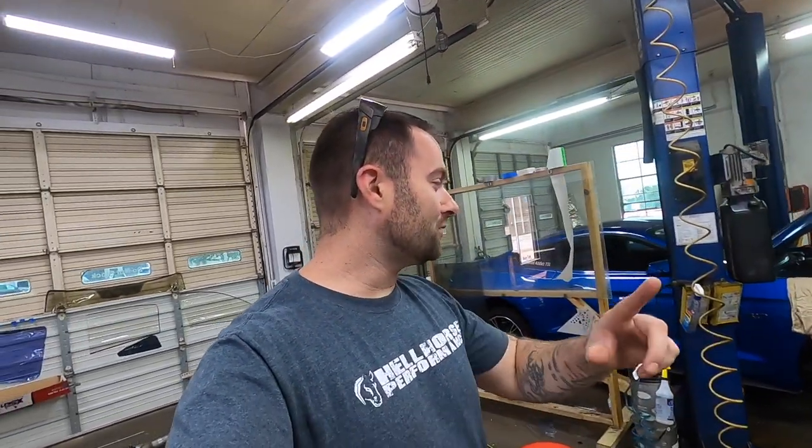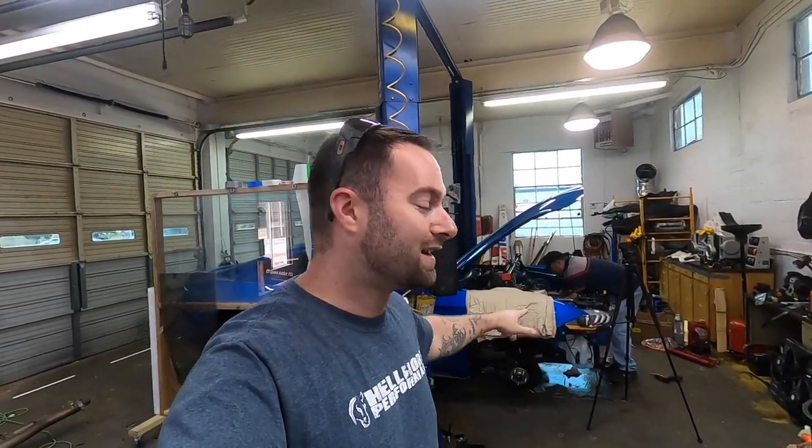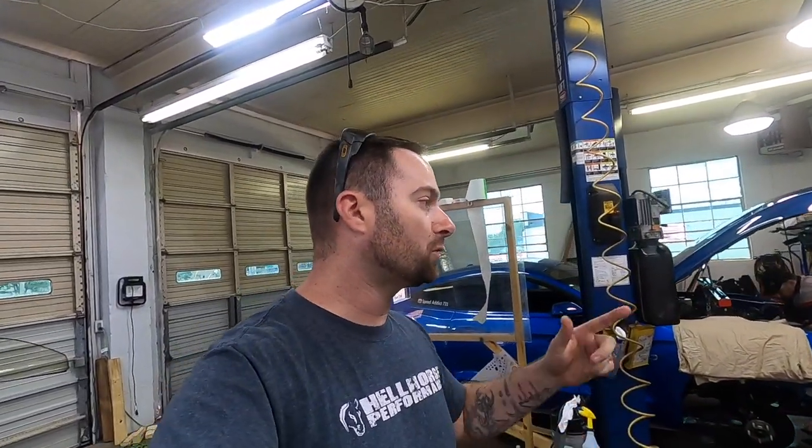So yesterday, what did we do yesterday? I can't even remember what we did last day. Dropped the K-member. That's right, we did. We dropped the K-member completely out. So turbo manifolds are on. The easiest way, if you have a lift, is drop that K-member. It looks really scary, it looks really frightening, but it makes a header install about a 10-minute process. Honestly, it's not that bad. It's only like 6 bolts per side, plus the motor mounts on each side, which is 15 millimeter, and the whole thing just drops free.